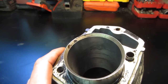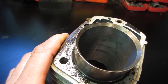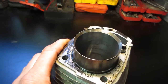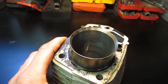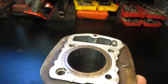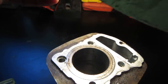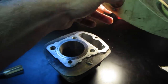And then you could also see all the pitting. I wouldn't say scoring; it's more pitting than anything. It's a 46-year-old motorcycle, so I'm sure it sat for long periods of time in its life, and that's just what it looks like when that happened. You can see those two distinct different lines down there. That's probably two times where the piston sat for a long period of time and just got some corrosion and pitting. So while we're in there, we are going to replace those also.